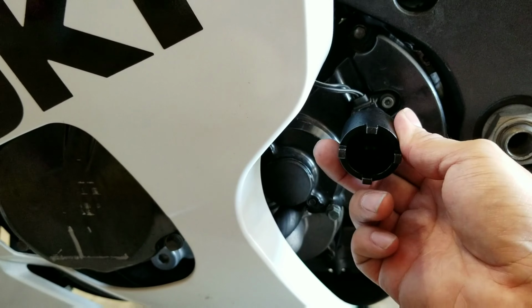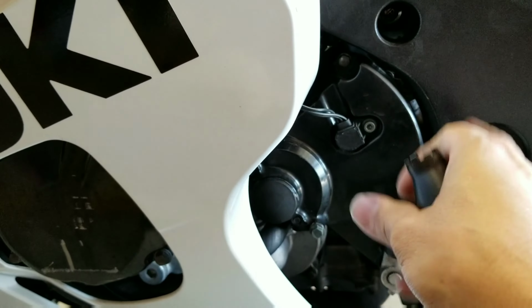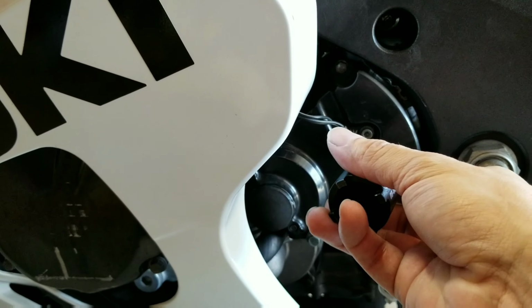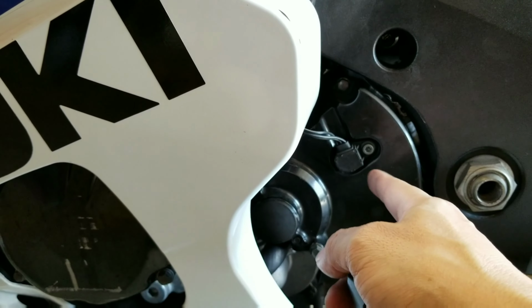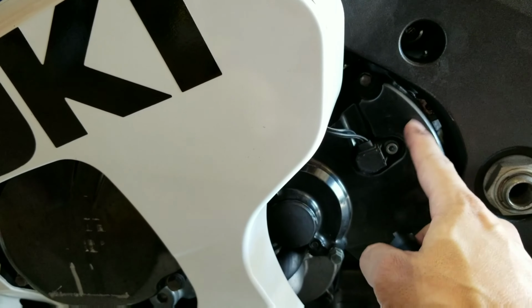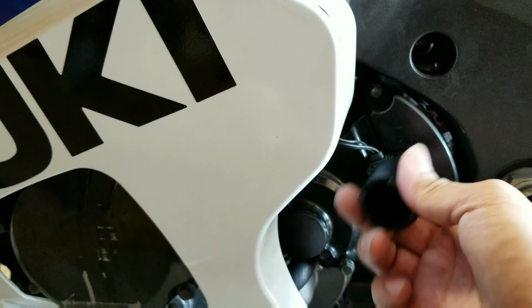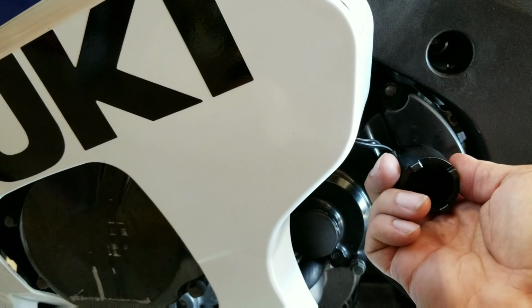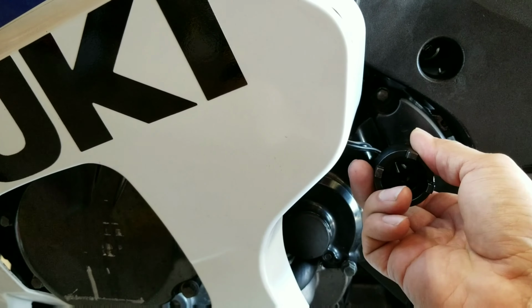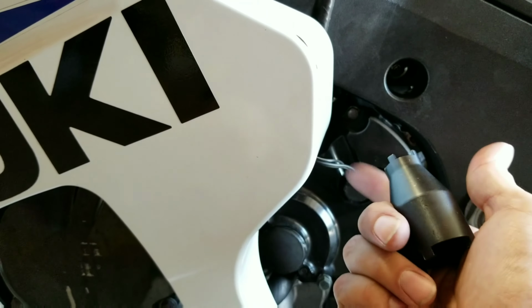And you're going to go ahead and loosen that. You're going to put it in a gear so it doesn't spin on you, and you're going to go ahead and crack that bolt off. It will have an Allen head on it like this, and then you're going to have your pickup sprocket. Just put this over that Allen head bolt and into the pickup, and crank it off. You don't need to stick a tool in here, it will automatically loosen on its own.